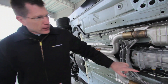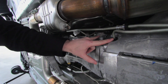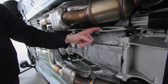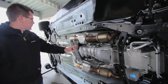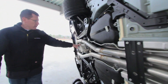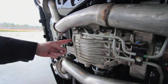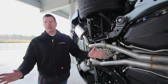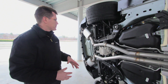Here are the cooler lines for the TR 6060 Tremec transmission. We have a little gerotor pump — we pump the transmission fluid forward through a heat exchanger in the bottom of the radiator, then pump that fluid all the way back to the rear of the car and through an oil-to-oil heat exchanger in the differential. That chilled oil comes back, goes through the rear diff, and the fluid is still cool enough to go back up to the transmission, maintaining both the trans and the differential at peak operating temperatures.